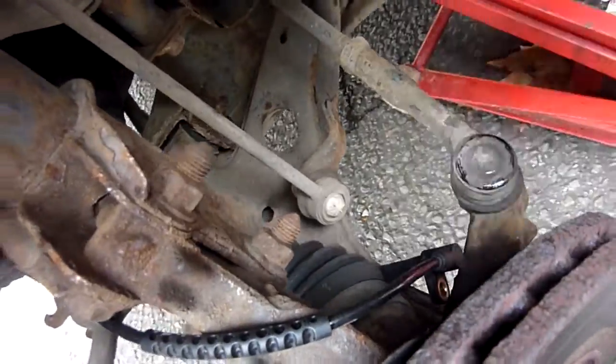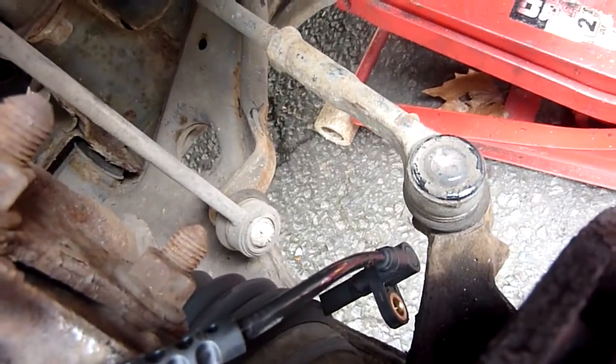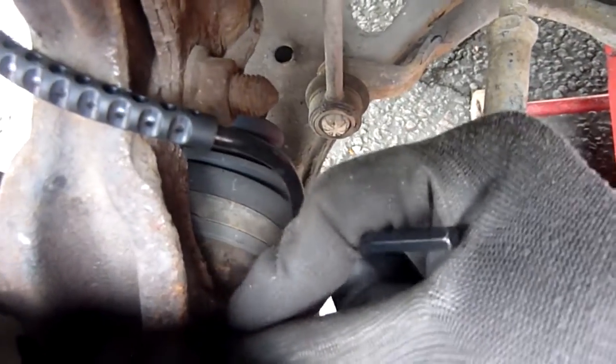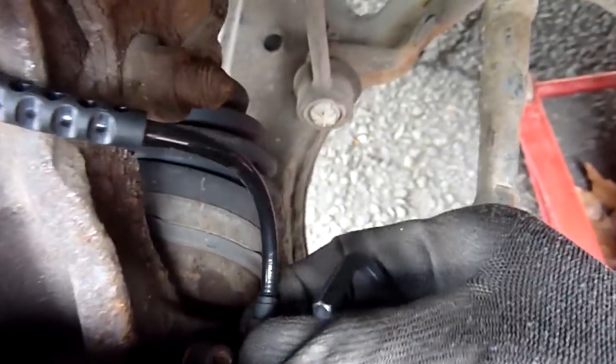If you're doing this job, try to test the sensor before you install it. Last thing - grease it up with contact spray and then reinstall. It only goes one way, so make sure you buy the right one. The hole needed a bit of cleaning as it was a bit small. Tapped it in gently with the back of a screwdriver until it was dead flush. Had to put a nut on the bolt because the hole wasn't threading properly, but it's firm and flush now.